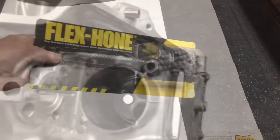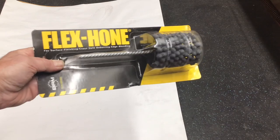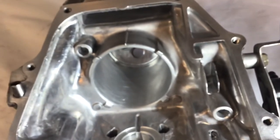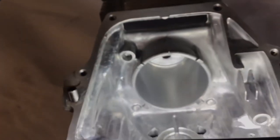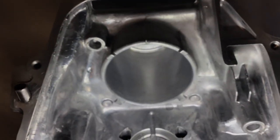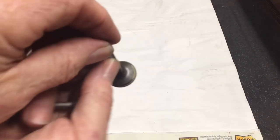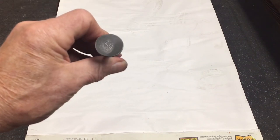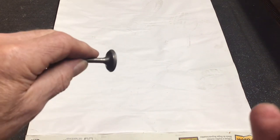When I put on the new rings they had a lot more spring to them than the used ones I took off. I think it was a combination of both issues. This lawnmower is eight years old and used on a fairly large lot — it has served me well and I really like this machine. Once it was put back together the problem was solved. There are many videos on these engines, especially the Honda 160s and 190s, on how to take them apart and put them back together. The purpose of my video was to show the valve stem seal replacement on the intake, but it evolved into a complete disassembly. This project was a lot of fun.